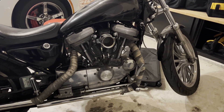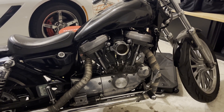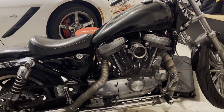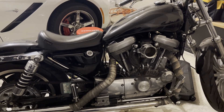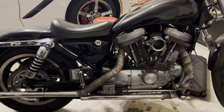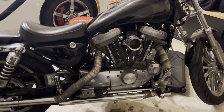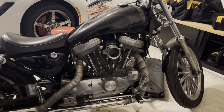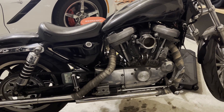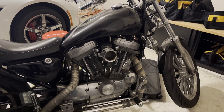There are two schools of thought. The Harley manual says tighten to certain torque specs, go 90 degrees more, then loosen and do it again — supposedly the first time helps the gasket seat, and the second tightens it up. But Cometic, who makes gaskets, says you don't have to do that — just tighten in steps, like nine foot-pounds, then 20, then 40 foot-pounds, and do it just once. That sounds nicer, so I'm going with the Cometic method.